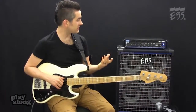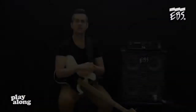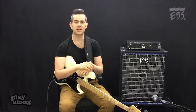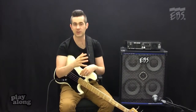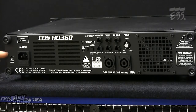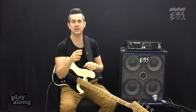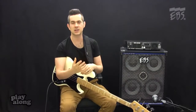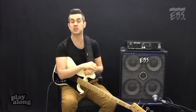So that's a round up of the advanced features on the amp — next up let's turn it around and have a look at the back panel. A lot of players just plug into the front, get their sound and never look around the back, but there are great features built in here that you should know about. Starting from the left hand side, our mains input is a three-pin kettle lead, industry standard, and they have a little fuse here which you can pop straight out. If your fuse dies in the middle of a gig, you can just pop the fuse out, switch it, and pop it back in — takes about 10 seconds.